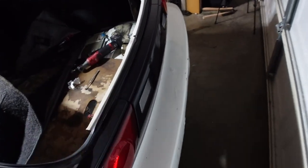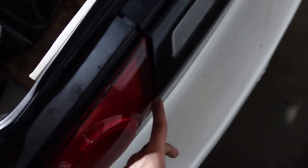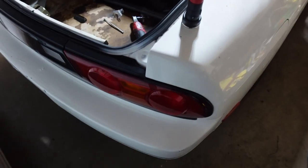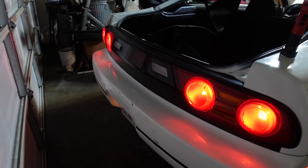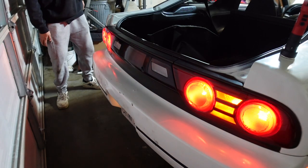I went ahead and got the tail lights installed. Everything fits pretty good — there's a little bit of misalignment that's kind of annoying me, but I think it's just because the car's not perfect body-wise. When you go on one side it's a little more flush than the other, and this tail light fits literally a millimeter too much on this side. Now I'm gonna put the rest of the interior back together inside the hatch, vacuum everything up from the mess I made, hook up the battery, and make sure all the turn signals and everything work.